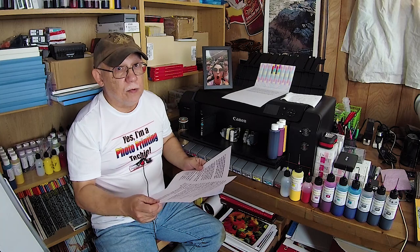When you have light magenta, light cyan, cyan, black, gray, gray, gray — you could make a grave mistake while refilling and put the wrong magenta in the wrong cartridge. The printer has no clue you did that. If you flip the magentas — put full-strength magenta where light magenta should be, or light magenta where full-strength magenta should be — you will have pretty much immediate color problems on the Pro 100 and the Pro 10.